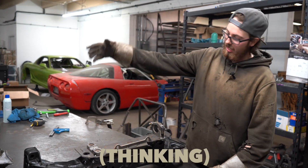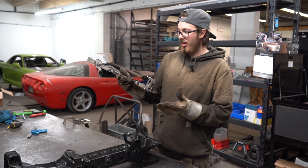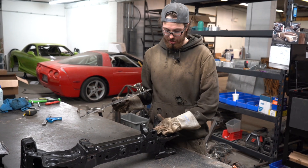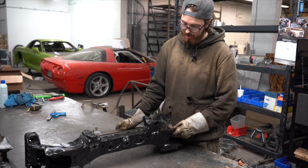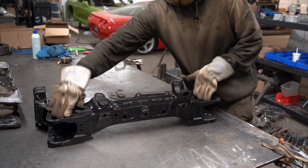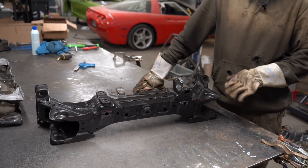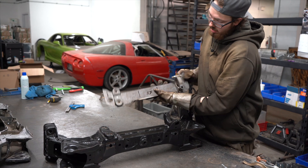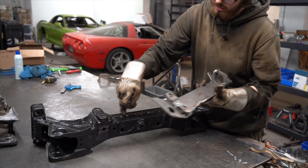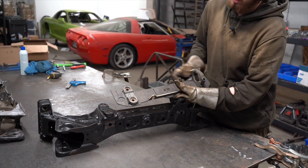This plate fits on that. As you can see there's quite a bit of cutting to do to make this plate fit. More or less what we're trying to achieve here is just make a flat plane from where your lower control arm bolts up, straight across, so that from here to here we have a nice flat plane that our plate can sit on. We have these slots in the plate which locate on ribs inside the subframe, and those will get plug welded for added strength at the end.